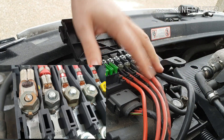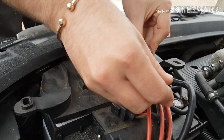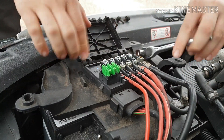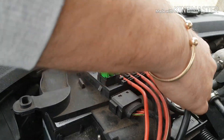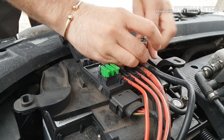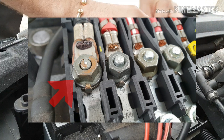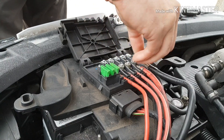There is definite high resistance in this circuit because of the temperature that was coming off of it — so a 10mm socket. The other thing I noticed was the nut that holds this cable down is discoloured, so there must be a lot of heat going through this.